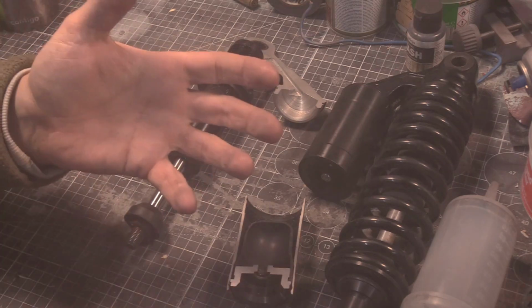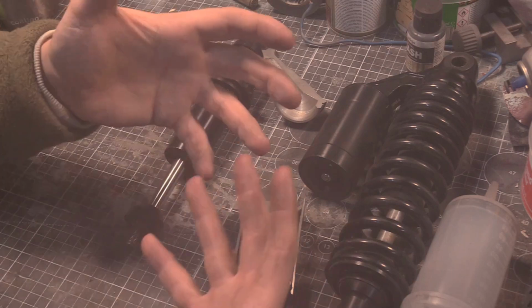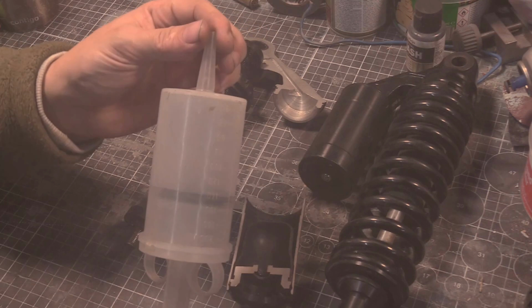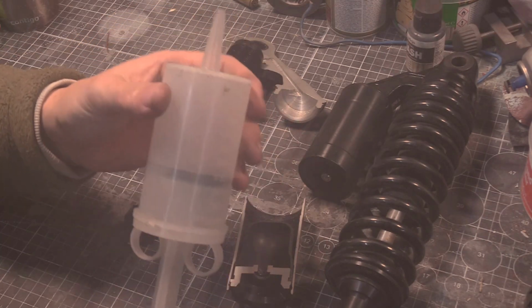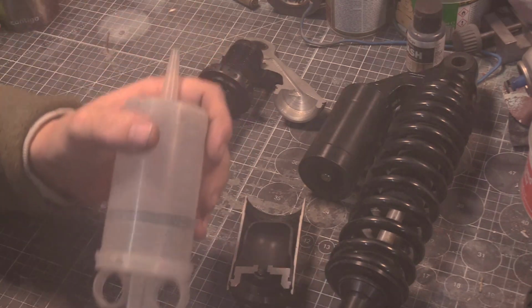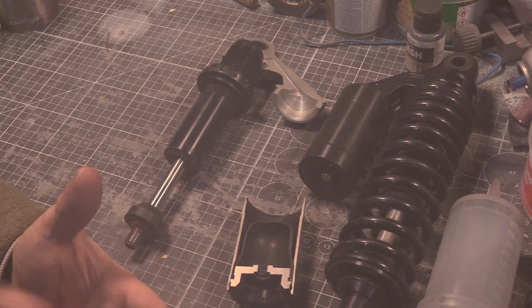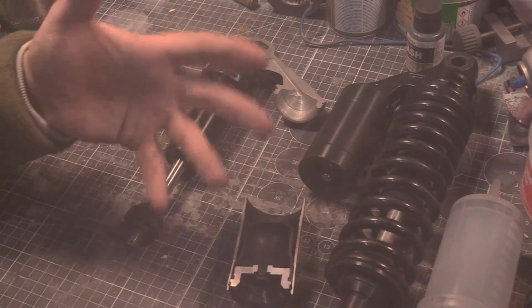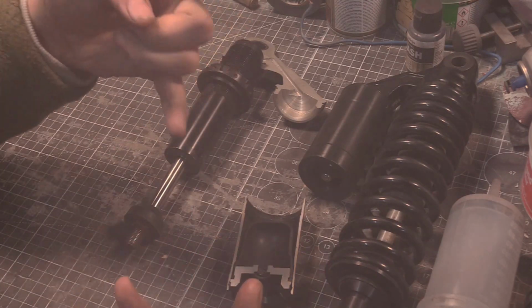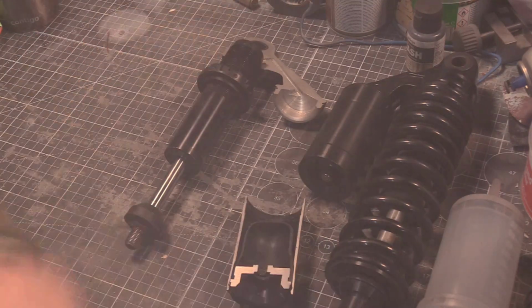The oil, the liquid, has a mass, and that means it has inertia, which means it resists wanting to move, wanting to accelerate from in here out of this hole, right? So it's not just the restriction. You have air in here, or you could have oil in here. The difference with the oil is the oil doesn't want to move, right? It has a mass. It also, because it's a liquid, it has an interaction with the other molecules around it, right? So they're not simple atoms, they're molecules, and they want to try and push past each other, and they get in each other's way, and that messes everything up.